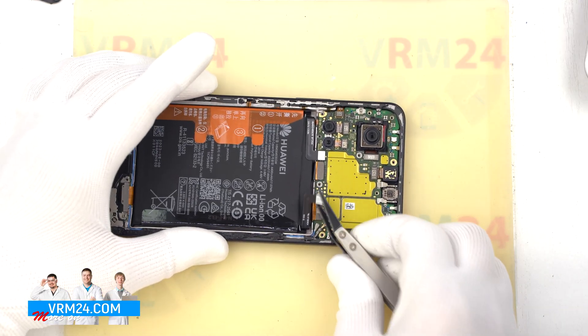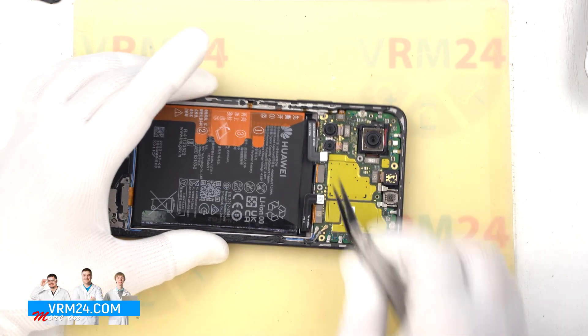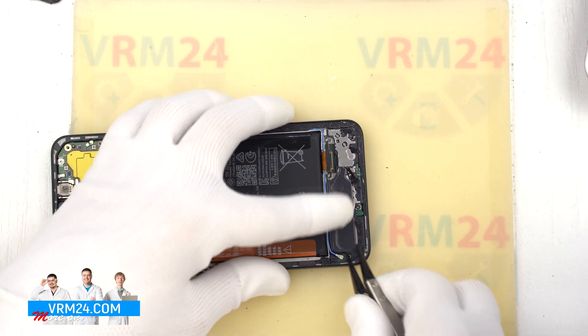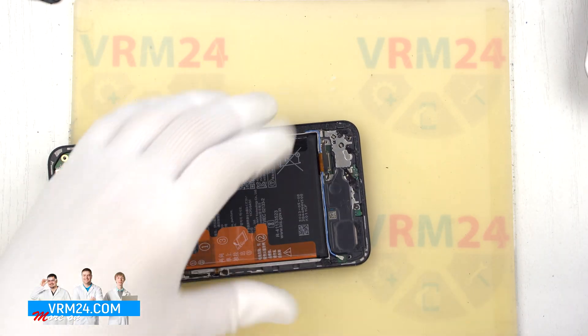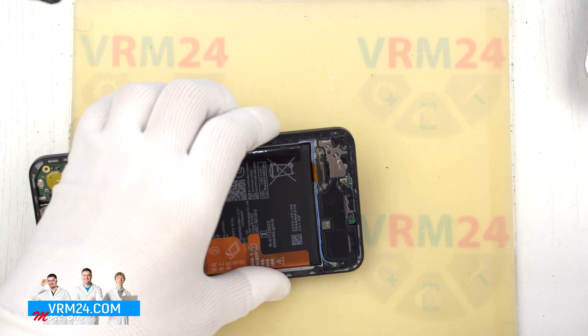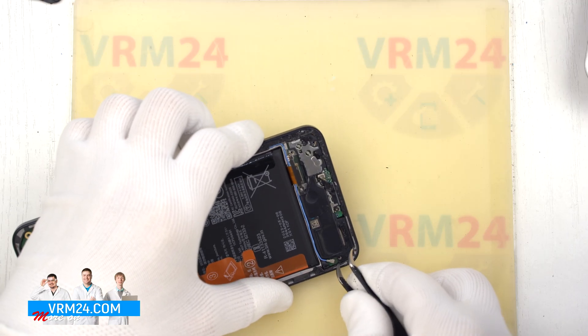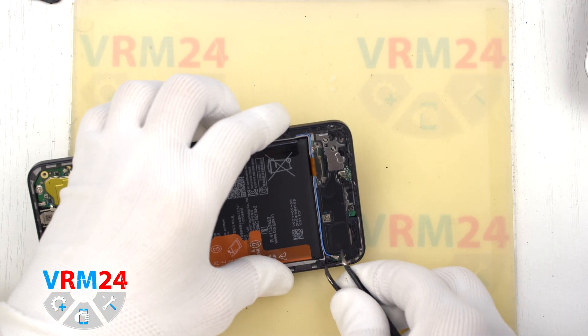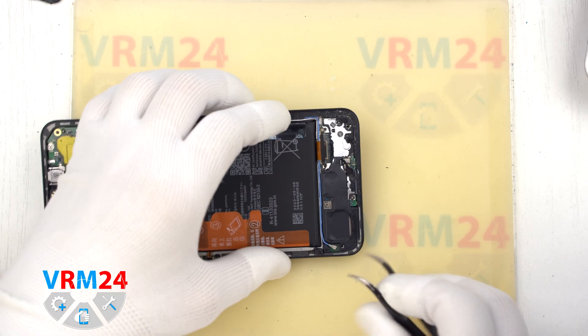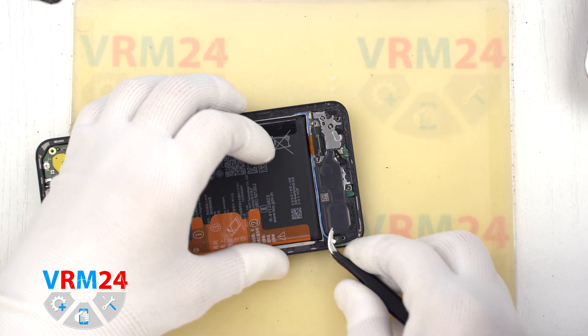The cover may be slightly glued — as we can see, there are contact pads and transmission lines. With a non-metallic tool, we disconnect the battery connectors and move on to the bottom. We need to first disconnect the coaxial cable connector so that it doesn't get in our way, then release the cable itself from its fixing groove in the frame of the display and collar. We carefully bend the coaxial cable aside.